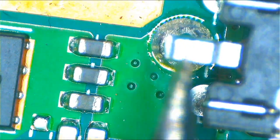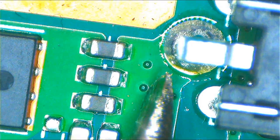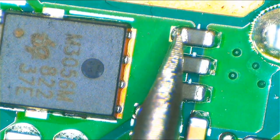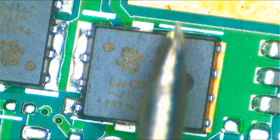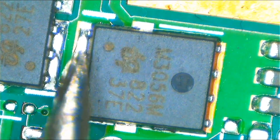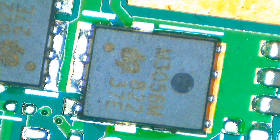This is the charging port — this is where the 19 volts enters. After that it passes through these three coils or inductors, then it goes to the first MOSFET. From here on the first MOSFET, this component doesn't allow power to pass — it only allows 0.9 volts through, which is not enough. Let's quickly remove this MOSFET.